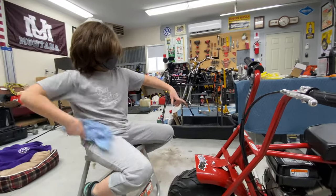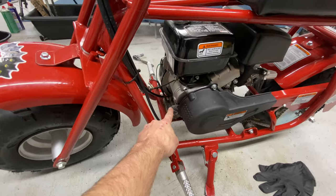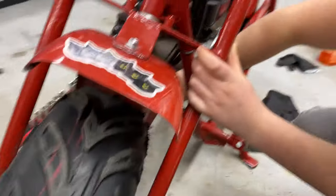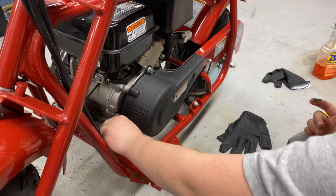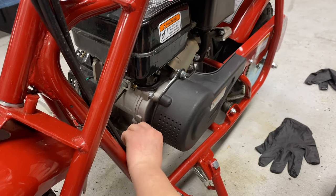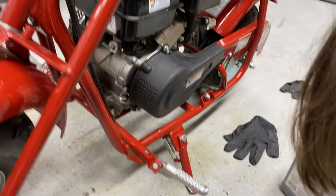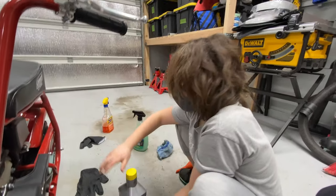Time to put the new oil in. So take your dipstick, your filler cap off — it's right there. So it's lefty loosey. Oh, that is hard. So go ahead and turn that out. You're doing it, Peter. You're Peter and you're doing it. So we'll have to use that as your fill plug. Grab the funnel next to you. That's the oil funnel. So funnel goes into the hole like that, and then you pour a little bit of oil in, but do it very slowly.